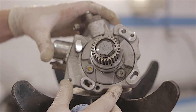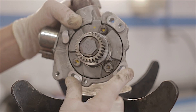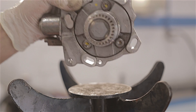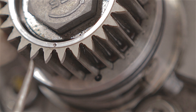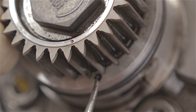So going by that theory, if your high-pressure fuel pump is not aligned up properly, it's out of balance and it can potentially damage your camshaft drive belt. Take it as you will. Now this particular high-pressure fuel pump is held on by three bolts. Although the two bottom ones have got slots in them, there is no adjustment on this pump because the top stud holds it solid. So once this goes onto its studs, you can't move it — it goes on in one position only. Timing this pump up is pretty straightforward: on the cog, you've got one little dot, and you turn that around until it lines up with a hole in the casing. And that's it — that's your pump timed up.